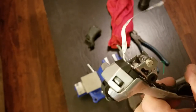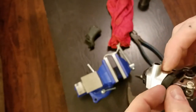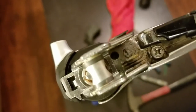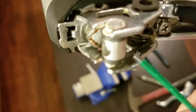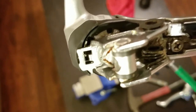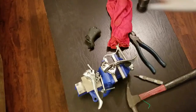When you do pull that out you will have this little dust cover fall right in your hand - just pop it right back into place. If you're worried about the position of the shifter, you can see this is the way it was. On the left side you have a hole that the spring falls into and that's where it sits flat. Go ahead and take that out, remember that position, and pull out these little sleeves and swap them over.